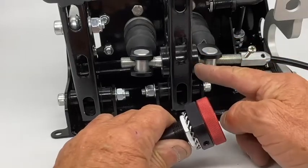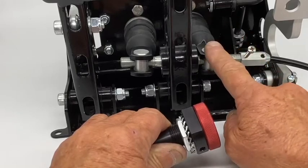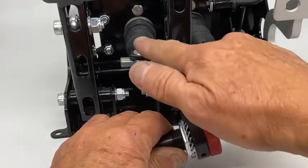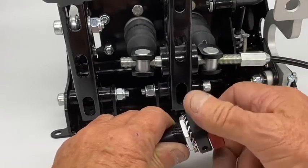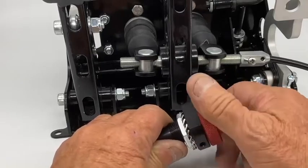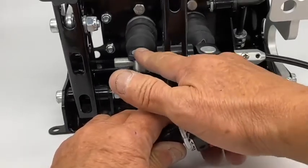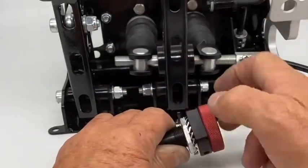When the bush on the balance bar is fully over to the right towards this cylinder, this cylinder is getting more pressure than this one. If you move the balance bar over to the left, this cylinder is getting more pressure than this one. In the middle it's 50-50.